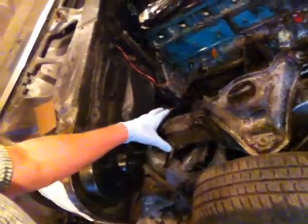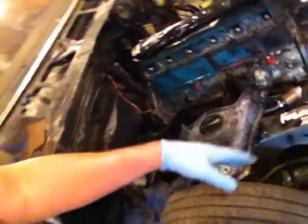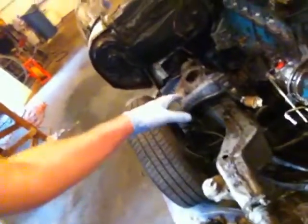But I don't want to do that until I've got the primer in hand and the car is masked off and ready to prime, because I don't want flash rust in between. So it'll be sanding it, wax and grease remover, and then having at it with the primer, and then paint. So primer can go over everything. So I'll just go bonkers with that. Maybe a section at a time, like do the frame and the control arms, those things. Like do that section first, and then maybe over here, and then in there, I don't know, firewall separate.